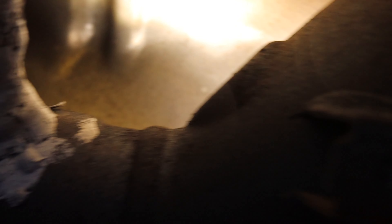It's a smoke machine, so once it starts going you're gonna have to limp it. A lot of it leaks out anyway, but the leak is down there by the cat as expected. So we have found our exhaust leak — right there. It's not coming through on camera, but that area is black and the rest of it is kind of a rusty brown, so that's where it's leaking. It's up at the heat shield. Nothing but some steel wool and JB Weld. The inner clip was lost in the fire. We were going to show you a product apparently for high-heat exhaust, but it turns out it was crap and did absolutely nothing.